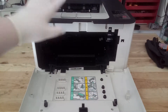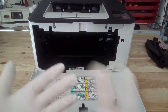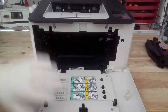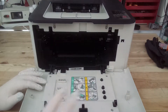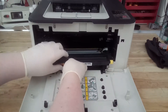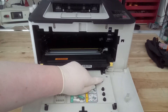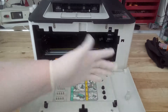Now let's proceed disassembling the printer further. I went ahead and put on some gloves because in the last part of this video I got a lot of the powder on my hands, and this can't be really healthy — it also discolors the skin. There's nothing else I can easily remove here, but the front part is really interesting. Let me grab a toner — they sit in like this. You see these black things, they are buttons. They go in here, and if they are triggered, the printer knows that a certain cartridge, a certain color, is inserted. And if it's not pressed, there's no cartridge.